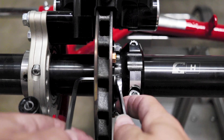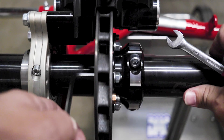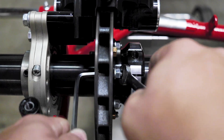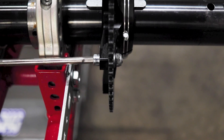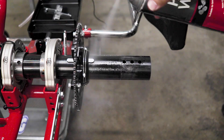You're gonna want to loosen up the brake hub. It helps sometimes to loosen up the rotor on the hub and then loosen up the bolts on the brake hub. When it gets tightened down with the five or six bolts holding everything together, loosening those up lets everything open up. Then do the same thing with the sprocket hub — loosen up the three or six bolts around the sprocket hub along with the one or two bolts pinching down on the axle. After you loosen all that up you can go ahead and slide that off.